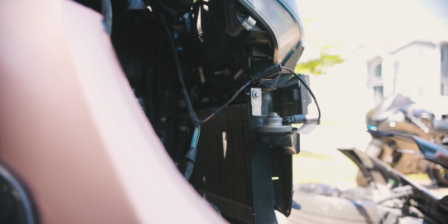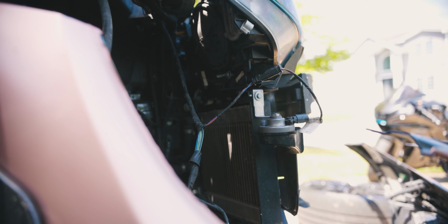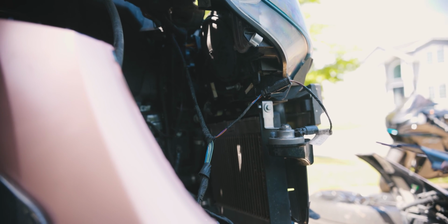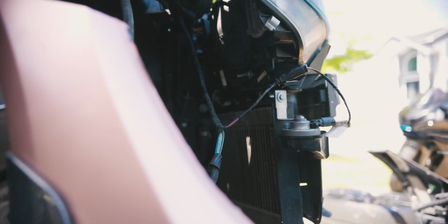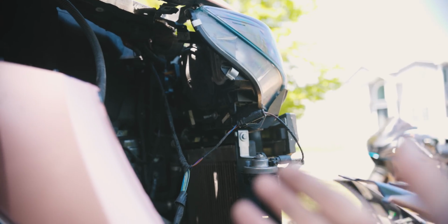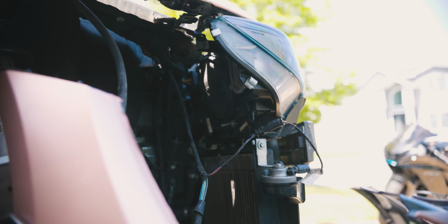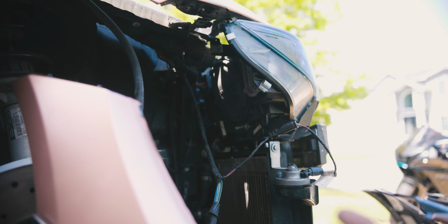But I used my impact and I drilled it tighter until it started heating up red. And I literally saw smoke coming out. That pretty much allowed the metal to expand and mend with each other. And from there, I just backed it out in one go and it popped out. So it worked on both sides, both bolts. Basically, I just drilled it tighter against itself until it started literally stripping and flaming up. I don't recommend doing that because you don't want to cause a fire around these electrics. I was literally about to get a Dremel and just start cutting the brackets off. But luckily I was able to get it out just by over torquing it until it started heating up and just backed it out.